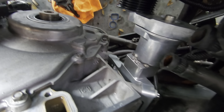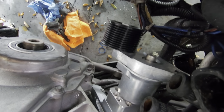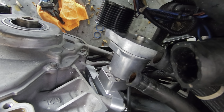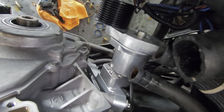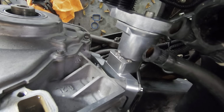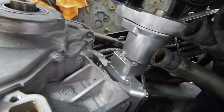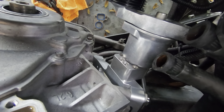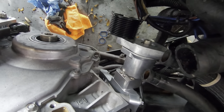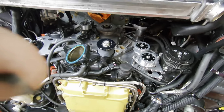That's it. All right, I'm gonna take you in here and show you what we've done. Again, there's the tensioner, the 10 rib tensioner. We've got one bolt. We torqued that to 25 foot-pounds. It's indicated on the dowel on number 3 on that clover mount, which is inserted into the bracket, which bolts onto the AC lower mount, right? So that's why this kit requires the high mount AC, because it's gonna use this lower mount here for that bracket. So that's a big thing there, okay?